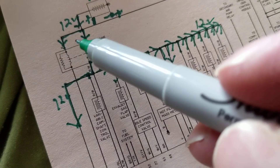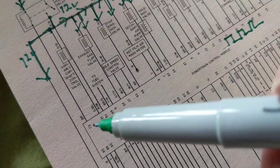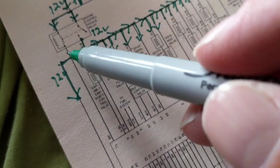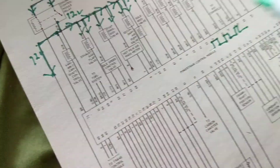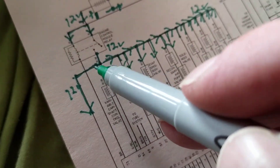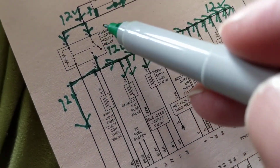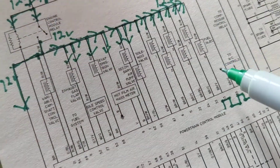What happens after that? Well, 12 volts here, 12 volts going to this pin. Actually — if this is ground, this will get maybe zero volts, or maybe there's a transistor in here like in another example, or some other device. There could be a voltage there, but it'd be less than 12 volts for sure. We don't know what's in here, but this is closed — 12 volts to all these things.